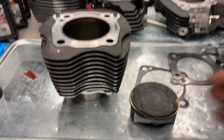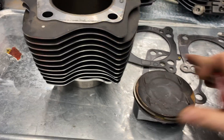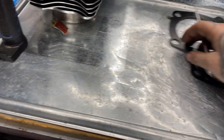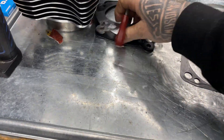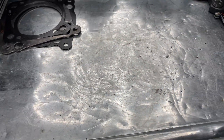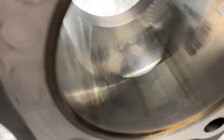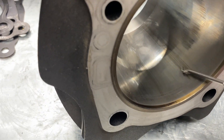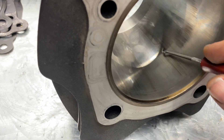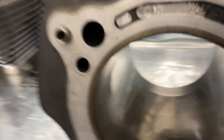Unfortunately, the bike that left here didn't have heat issues. There is bad evidence pointing in the wrong direction for what actually happened with that bike. If you can see this cylinder here — it's a little hard with the lighting — you can see marks: there is ring chatter. And ring chatter means this has gotten hot. There is obviously a lot of glazing and different things going on. This is a stuffed cylinder.